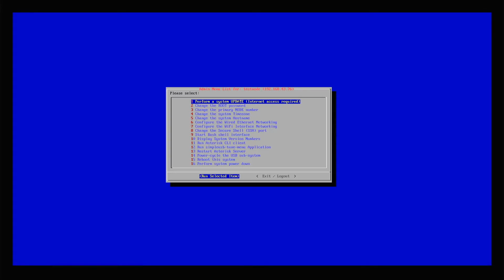So now that you've got that number written down, that's the IP address of the Pi. Write that number down somewhere you can get to it. You'll need it. That's the quick and easy way of getting the IP address since you've already got everything hooked up. Might as well make use of it. IFconfig, then look for the wireless LAN, and it's the IP address right there.